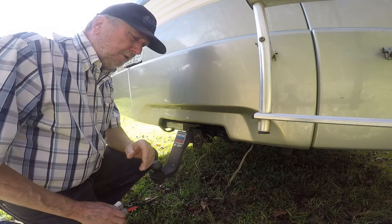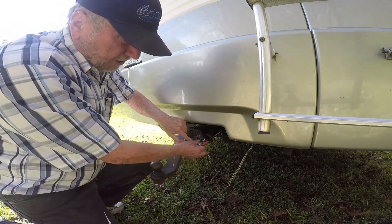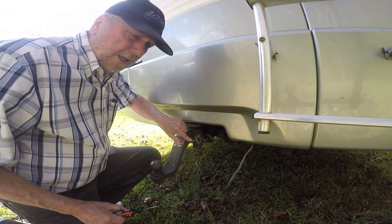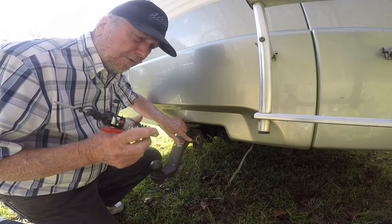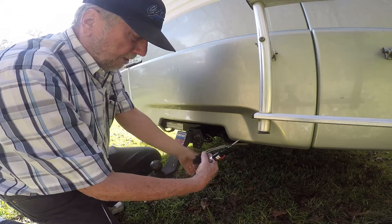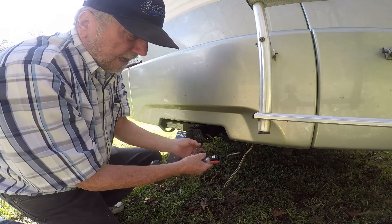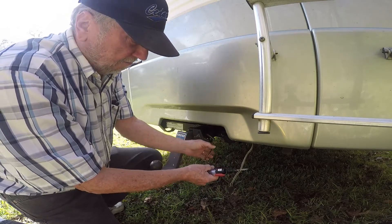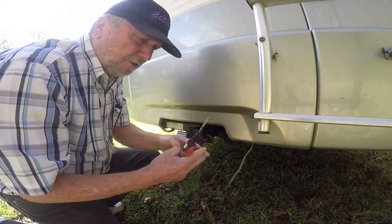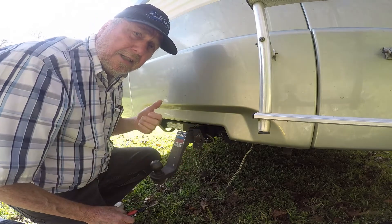Here's what happened. I have a little pigtail here which goes into my tow car — a spaghetti cord that goes back to light the taillights of my tow car from the lighting system of the motorhome. What happened is I accidentally forgot this, pulled my trailer hitch off, and pulled these wires loose where two of them shorted to ground, knocking out my taillights and turn signals.